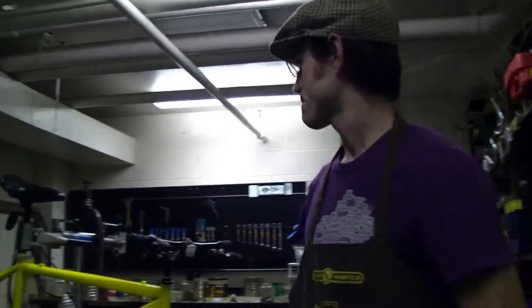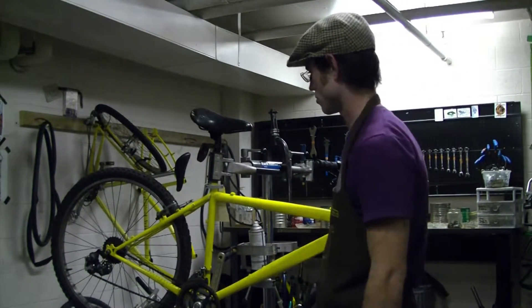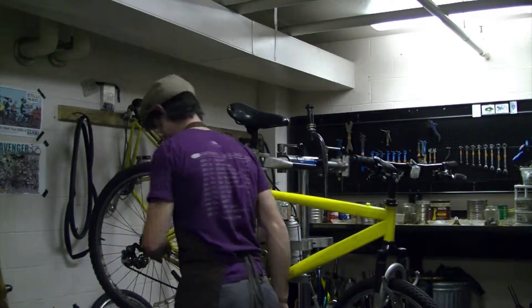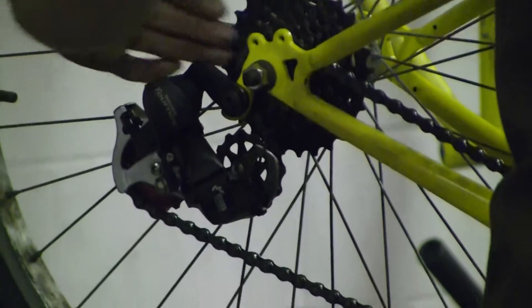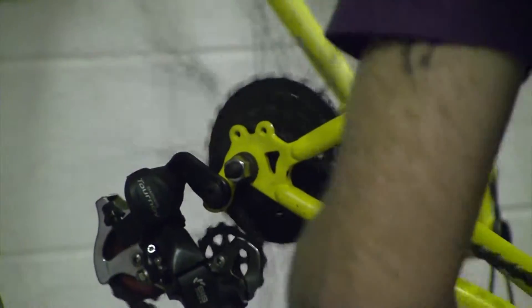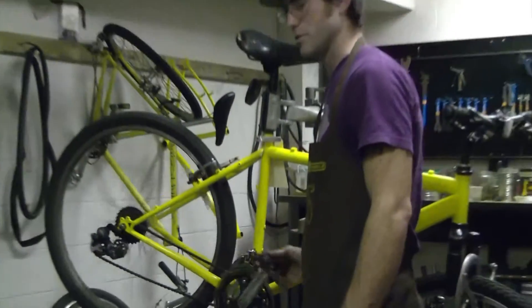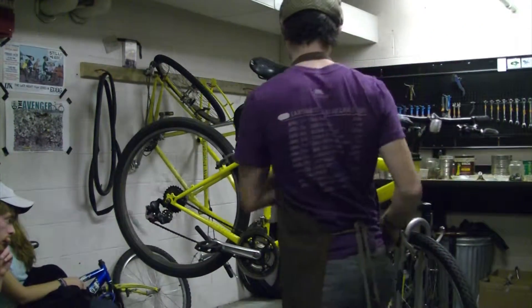It's starting to look like a bike you can ride on. Okay, so we've got the derailleurs installed, we've got the chain installed. At this point you're going to want to check the high-end limiting screw because it's really easy to do — just go ahead and look at it. What you're looking for is the wheels of the derailleur in line with the high-end cog of the bike. And it looks like they're pretty good. You can hear it rubbing on the front, so we'll go ahead and fix the limiting screws. These work independently from the cables, so we can do this now.